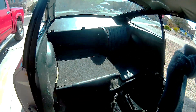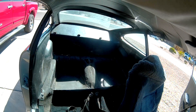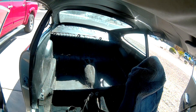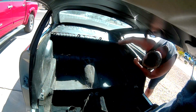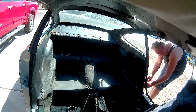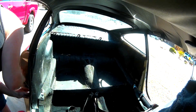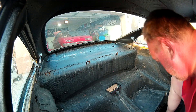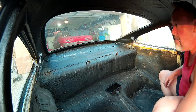Here's what it should look like when you're done — the bare interior. Go ahead and just start removing everything: seat bottoms, seat backs, the cover on the back, the package tray shelf. There are little window trim clamps right below the windows on the Porsche 911s, and undo the weather stripping for the door because that side panel leather wraps around the pillar into the door and the door seal holds it all together. Once that's out, take your time, clean it out, brush it down, wipe it down.